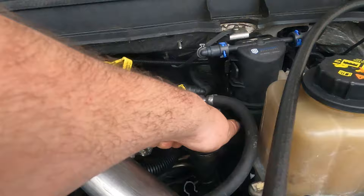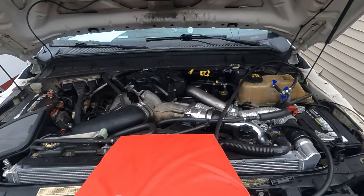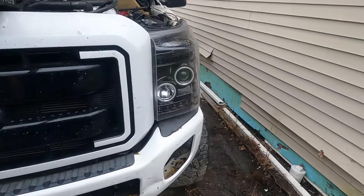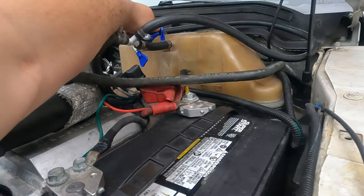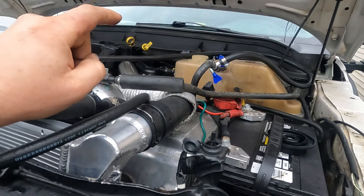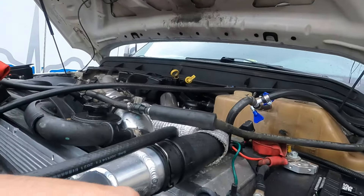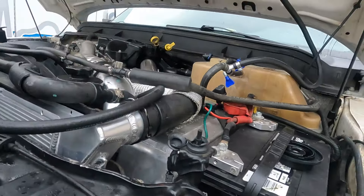I mean, it's what I would expect from a 270,000-mile tuned truck on 37s that's used for work — it's not the end of its life or anything. I did drive this truck down the road the other day and I think I put four miles on it before it started blowing coolant. It was all over — dripping down the springs, the suspension, it was up on the hood — and I wasn't beating on anything. The radiator hoses were hard as a rock.